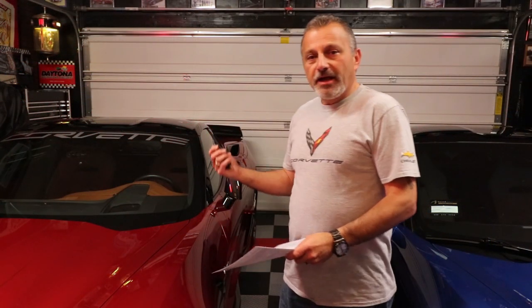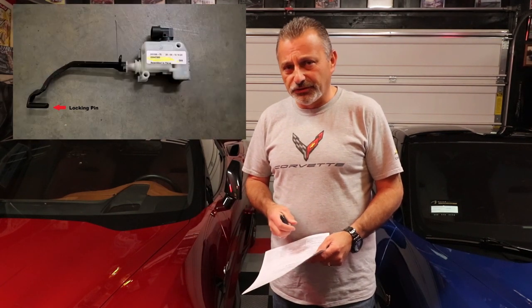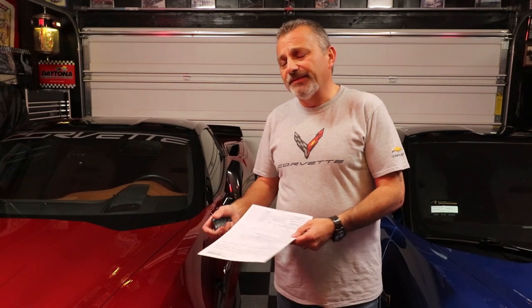I got the car back. As you know, I had taken it to Future Chevrolet for the gas door issue. They confirmed I was right — the gas door lock motor was bad; it had stripped the gear internally. Exactly what I had said. I was able to take advantage of the little bit of warranty I still had — still under a thousand miles under the limit — so I went ahead and let them take care of it. The part was only $60.33, so it wasn't a big deal, but the labor requires taking the back wheel off and taking the inner wheel liner apart.